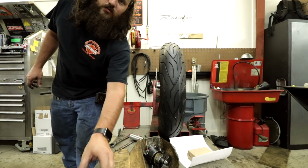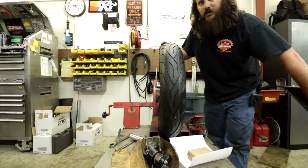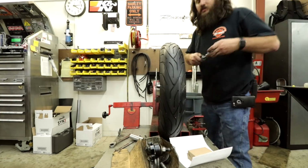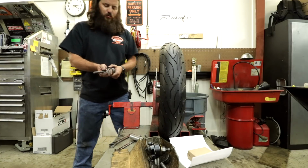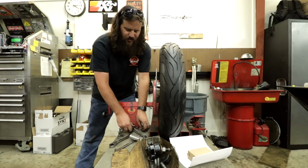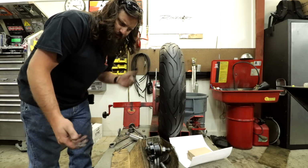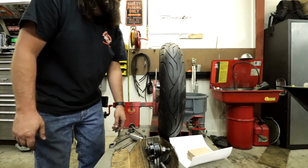Now, that looks totally insane, pulling a bearing out like that or smashing a bearing out like that, but the reality is that you can't reuse them anyway, because you pull them out using the inner race and you install them using the outer race. So you damage the play that's in the bearing. So, you know, it is what it is. That's faster. That's how I do it.